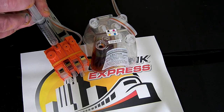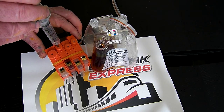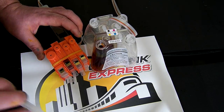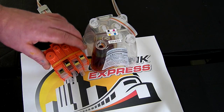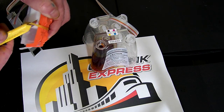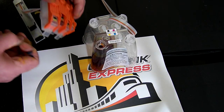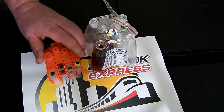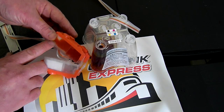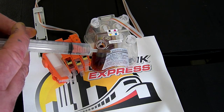Keep the pressure on until you've got a small amount of ink in your syringe — when you've got a small amount of ink, you know it's primed. Sometimes you do lose the pressurisation, or doing it once is not enough. So I'm going to take it out, cut this elastic band, and show you how full it is after one prime. We're nearly there — if you look at the cartridge we've just got that tiny little bit at the end. I'm going to expel the air from my syringe.